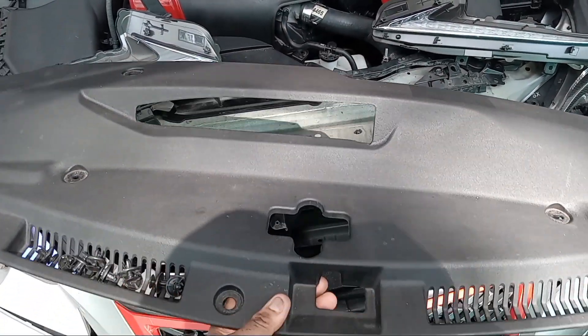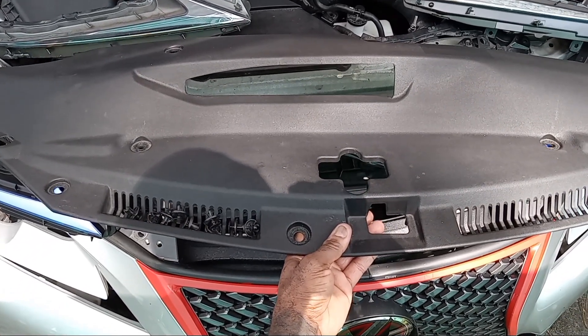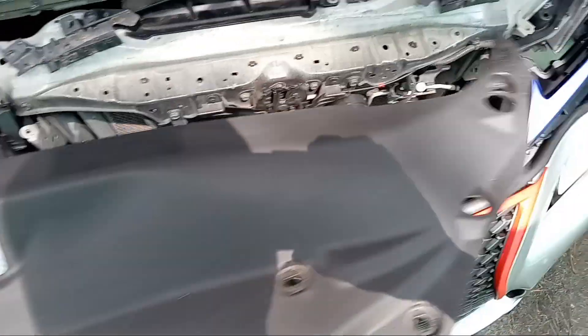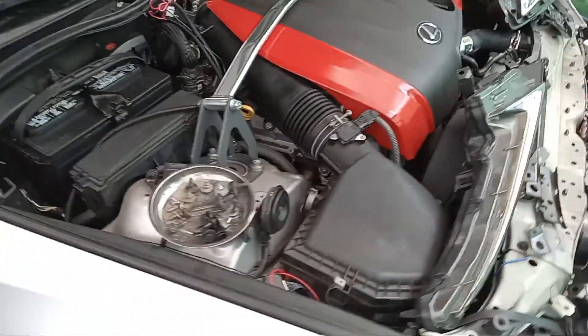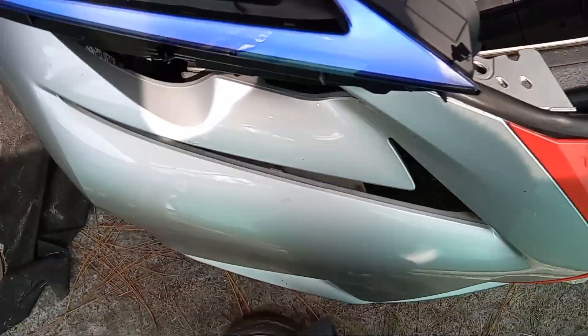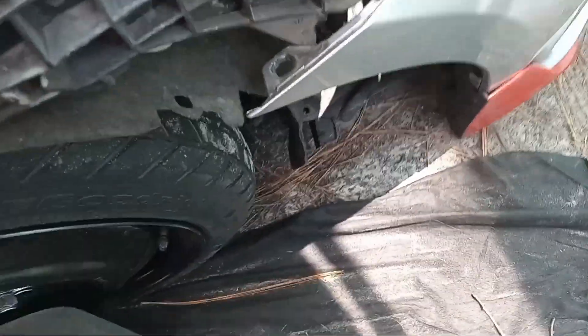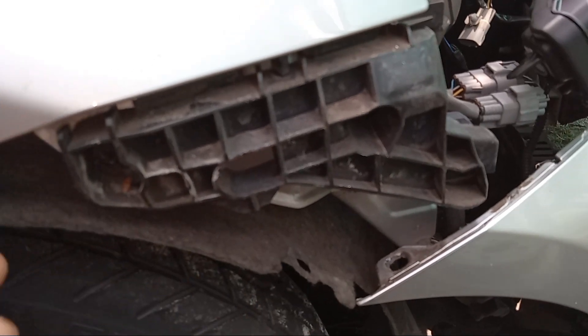You're going to have to remove the bumper to do that. First thing you're going to do is open your hood up, take this cover here off. Now you're going to have all these little push pins in there — you're going to take them out. That's going to give you access to the inside of your hood. Come down here, take those two push pins out, and go along the bottom. Right here, where my finger is, that's going to be a 10 millimeter bolt — take that out.